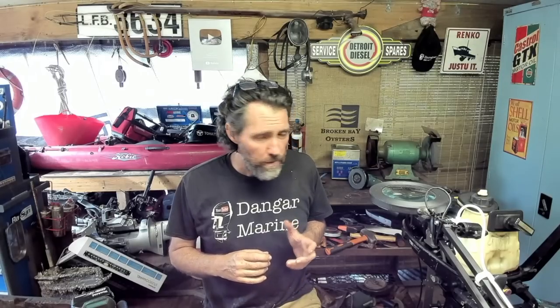What we're going to do now is take the power head off the little Tohatsu, have a look at the cooling system and the exhaust system. I'm going to do this pretty quickly because I think what we learnt last week will serve us well this week. We don't really need to understand where every passage goes — we just need to understand water that comes into the engine and water that comes out, and whether it only comes out when the thermostat's open.